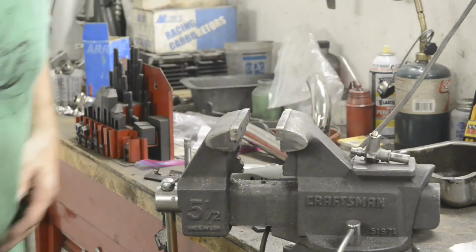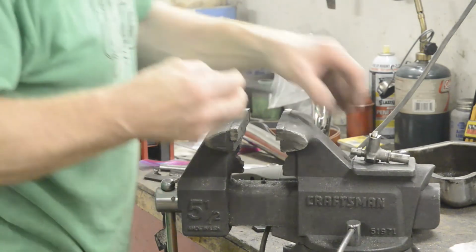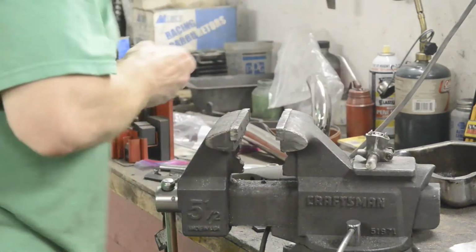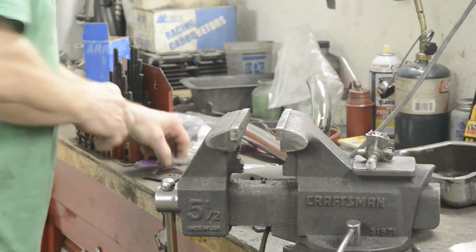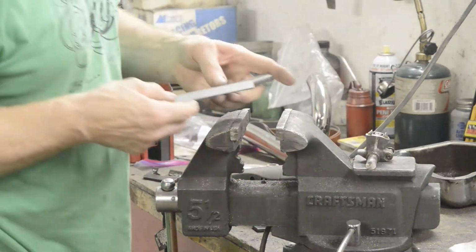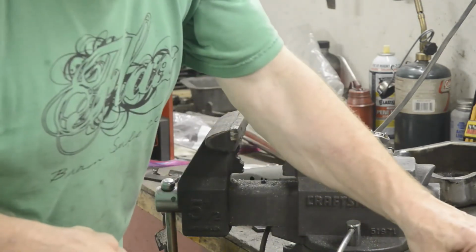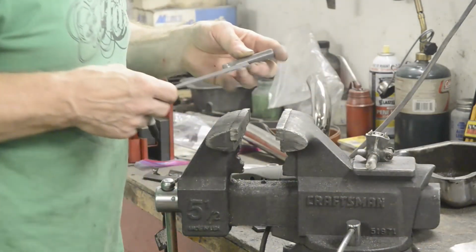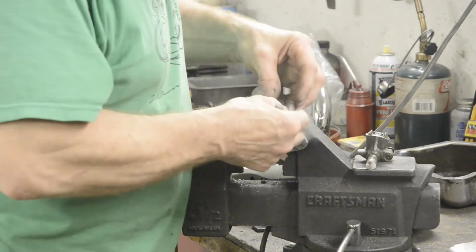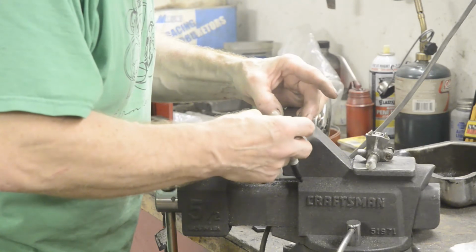So, there's that cut. We won't touch the bit on the floor. Now then, this piece that we have left is 1 inch, which is what I wanted it to be, because it made the maths easier. From there to there is 1 inch, and we want 2 5/8, that's 1 5/8 from the centre of these splines, or from the centre of the groove, to where we want to cut it. 1 5/8.